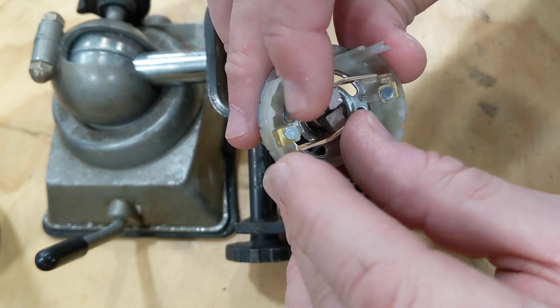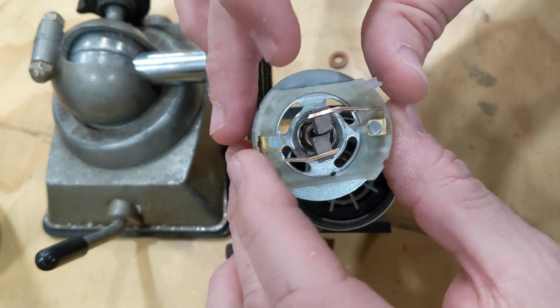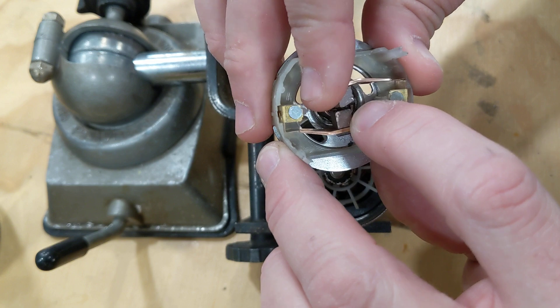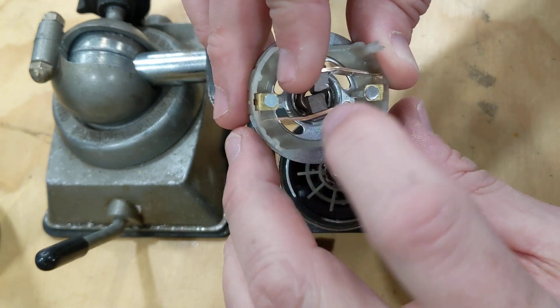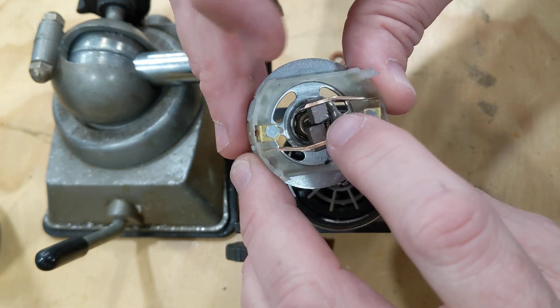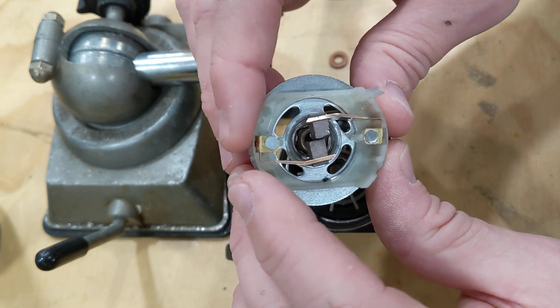So it's extremely important to do. The way you do it is just by running the vehicle at low speed for about 20 minutes — with our 775 motors is what we usually recommend. That allows these to wear a little bit, and you'll see the sparks go down over time as it's running, seating them in, which will give you a much longer lifespan and cooler running with the motor.